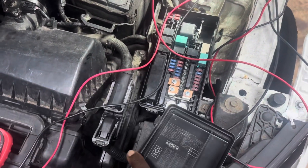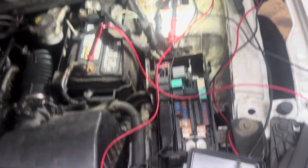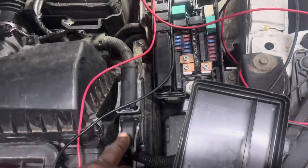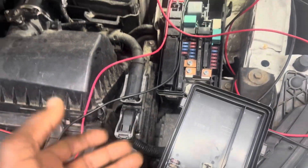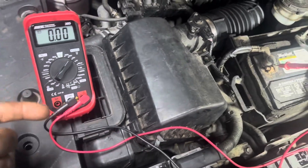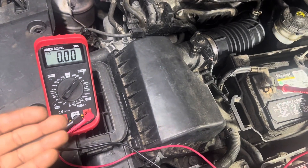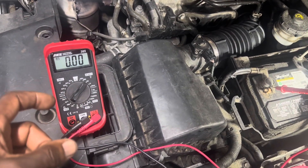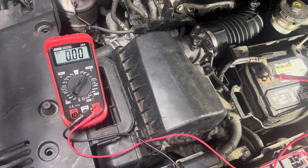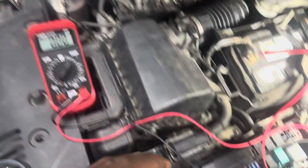The engine computer is located here. Also, leaving the alternator, it gets connected with that blue wire or light green wire and they come to the engine computer. Based on the charging system, if the alternator is charging 14 volts, you're going to see this line move to about 12 volts. From there, it will sense the information and the computer will send a signal to the alternator to adjust the charging based on the load in the car — whether to go lower or higher.